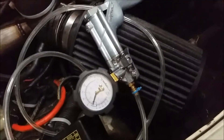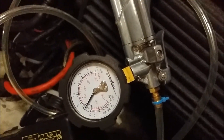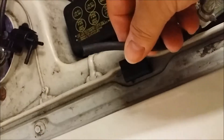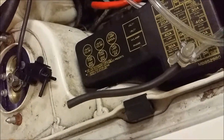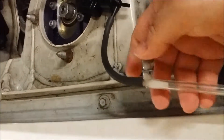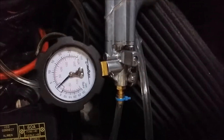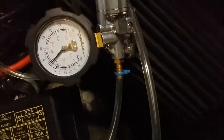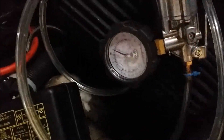What we got here is a Mighty Vac that goes to 30 psi. We're going to hook that up with this tube. I'm going to hook that up right now — it's hooked up to this T-fitting to keep the pressure in, since it's two different sizes on the tube. This goes to 30 psi as I said, so we're going to apply maximum pressure and see if it leaks.